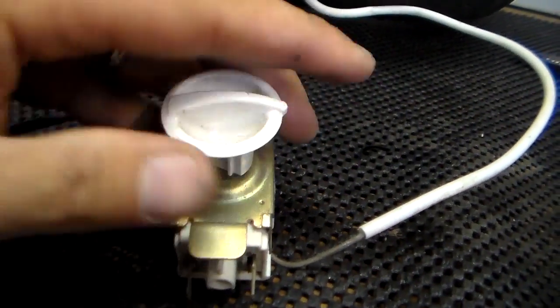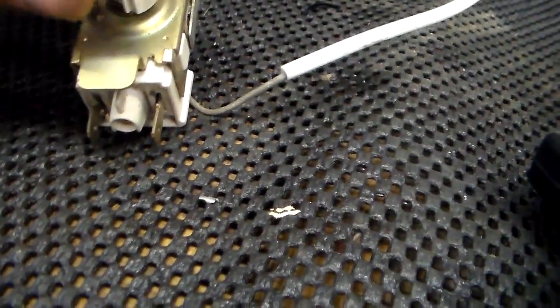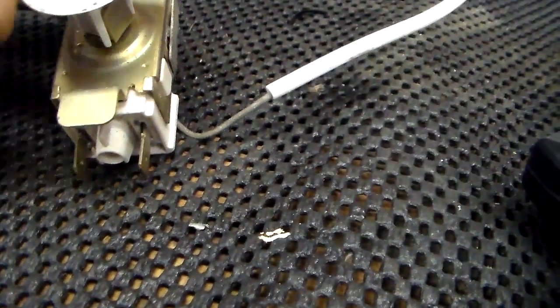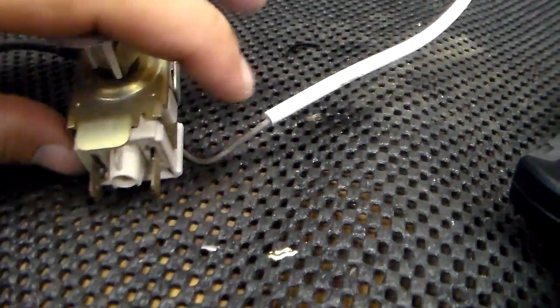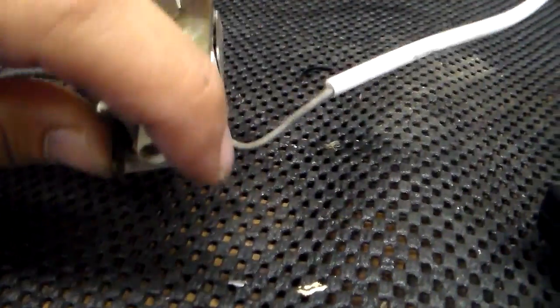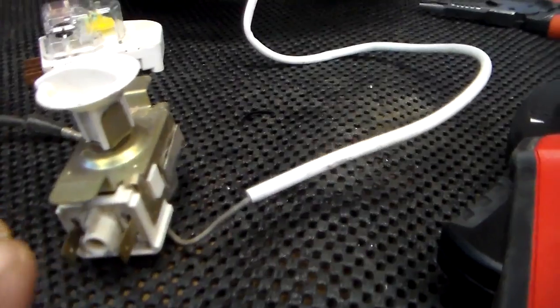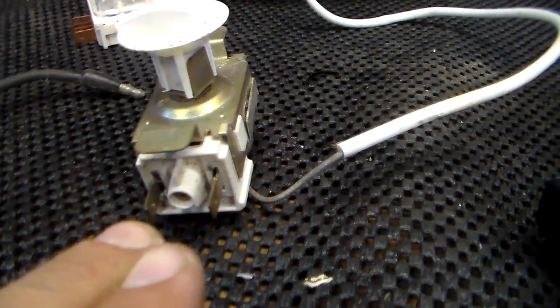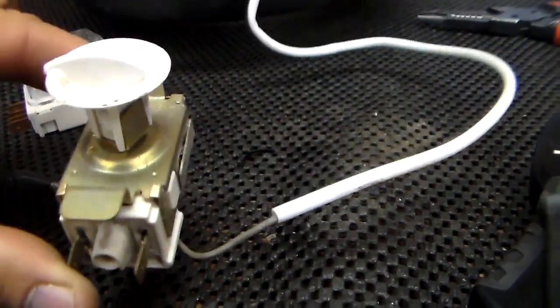When this is turned all the way off, it breaks the circuit between these two terminals. If your machine is not doing anything when turned on, then the thermostat is probably bad — especially if your refrigerator is warm. One quick way to test that is to take a piece of wire and short these two terminals together. Connect those two wires together to bypass the thermostat. If the refrigerator comes on, you're 100% sure the thermostat is bad.